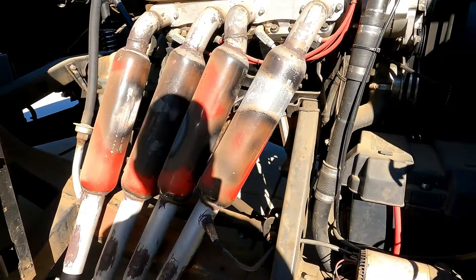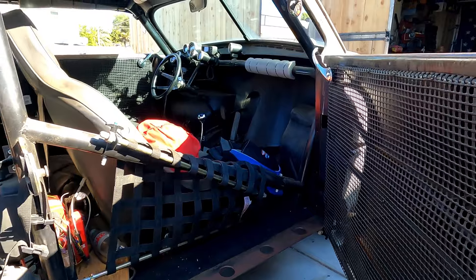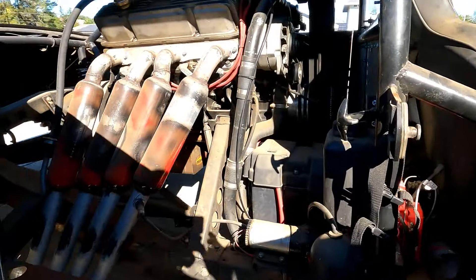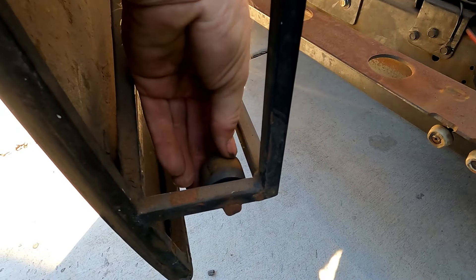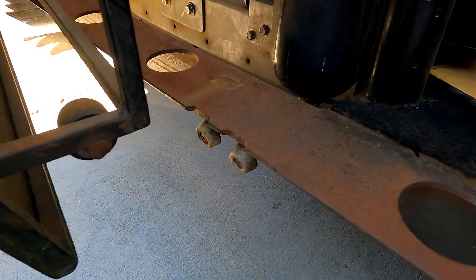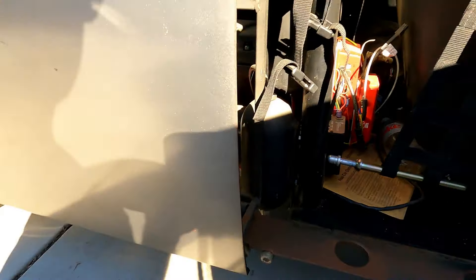These legs will come out and I can pull the engine out through the side. I've got spring latches and a safety strap latch for these doors. To keep the doors centered, I've got bump stops made out of door stops, and roller wheels — the kind used as chain guides on dirt bikes. I can adjust these stops, but the roller will hit and roll on the body, centering the door up and stopping on its own. It's a pretty good fit.